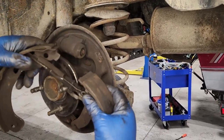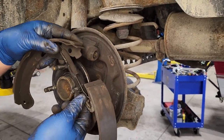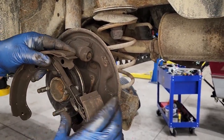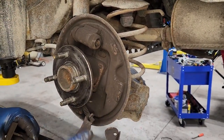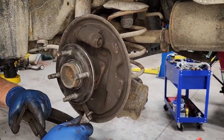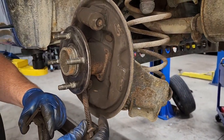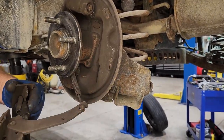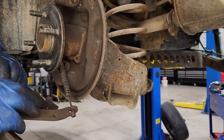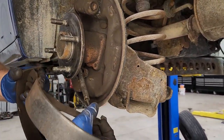At the bottom of these shoes, you'll see where the parking brake cable goes in. The reason why you loosen that bolt up where the parking brake is inside the cab of the car is so you can pull this cable out — it'll give you enough cable. You just yank it and it pulls the cable out. If you don't do that, you'll be fighting that spring that holds that on there forever. It's almost impossible to put the shoe back on also.